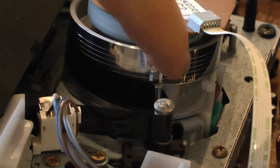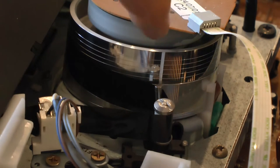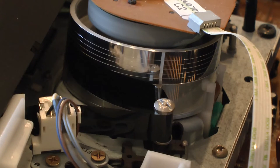When you're cleaning the head, as I said, clean it bottom to top. Basically you want to be using something like isopropyl alcohol — something that is a cleaner that's going to self-dry. You can also get cleaning tapes as well. They do work somewhat, but better still is to clean it yourself.